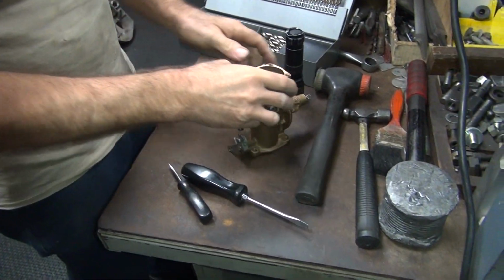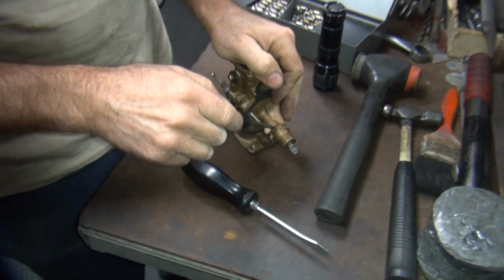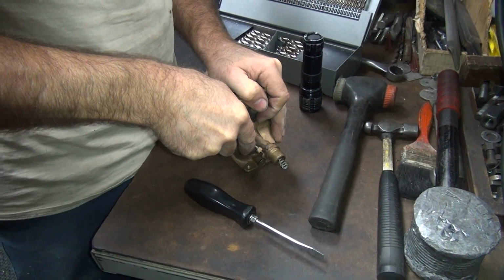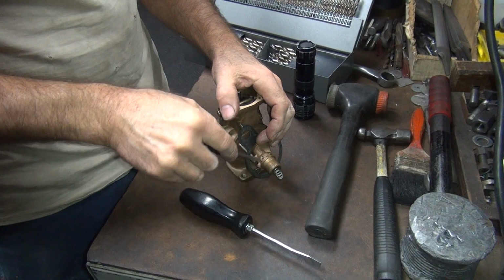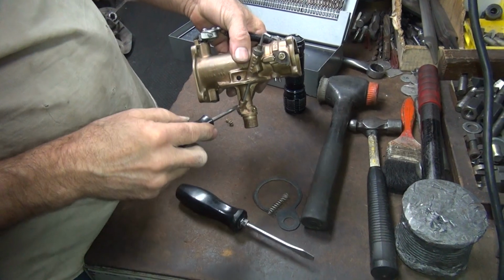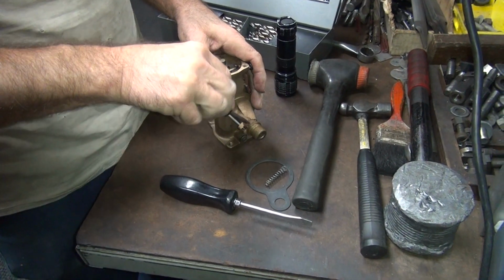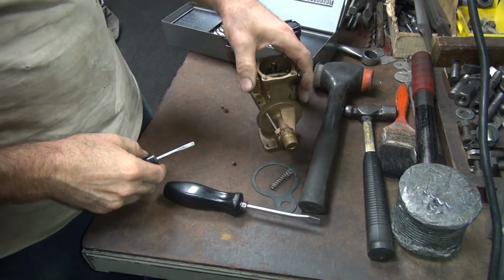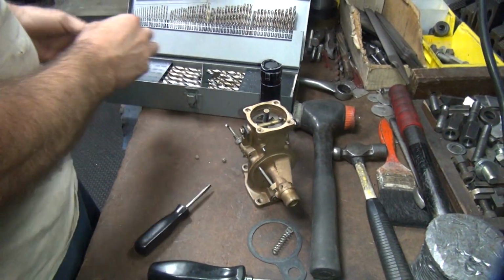Okay, here's where we plugged up the hole. That needs to be opened up now. Your screw is really bad. So evidently this carburetor does not like to be plugged. Can't plug them up all the way. See, instead of sucking out of here, it's sucking out of way up in here. We're just barely even getting float level in at that point. How come we put it in there then? Because it's feeding off of this because it's way too big of a hole stock. Oh. So there's your holes in there stock. Okay.